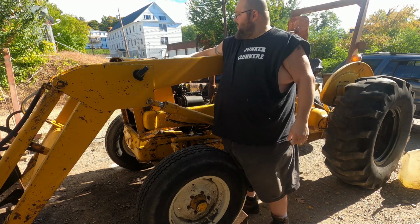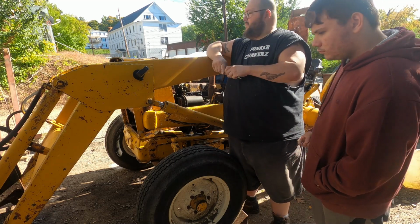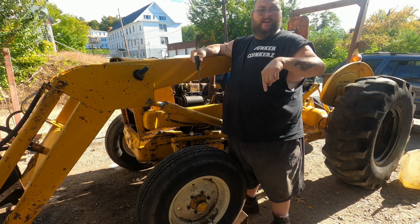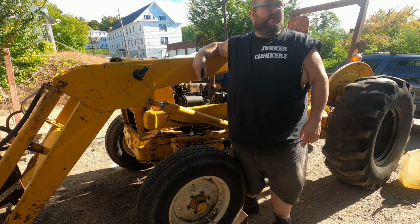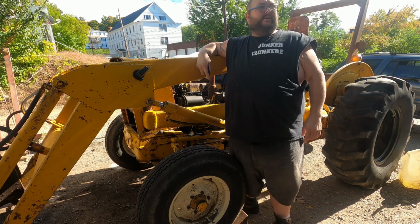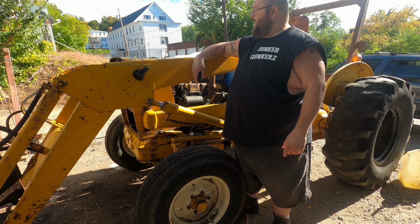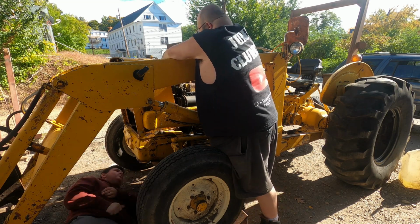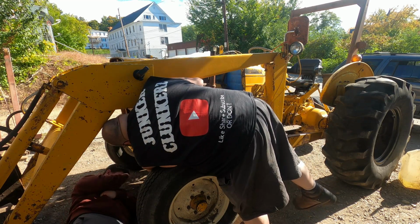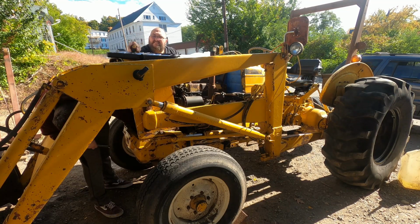Guys, there's a hose here, a hose at the bottom, and then two studs that come sticking down through the radiator on the bottom. I'm gonna have Brent crawl under there and start taking those off. What? And yeah, so let's just get going. A little bit of technical difficulty over here. I shall figure it out though.